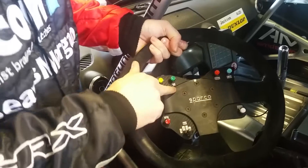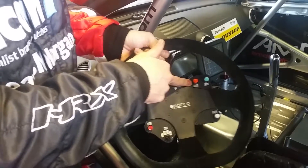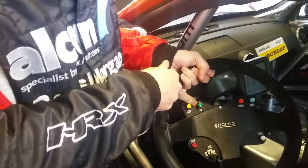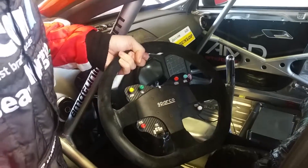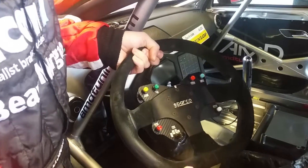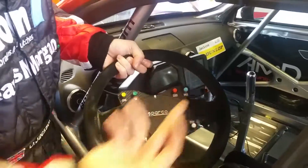These two are quite interesting — it's the push-to-pass and the brake button, though it's not really push-to-pass. All it is is a throttle and rev limiter that we use to start the car. The brake button locks the rear brake circuit. My procedure for the start is: I stand on the brake, hold the brake button — that holds the car in place — push the green button, put my foot flat on the accelerator, it builds up to the revs which is where you can hear all the cars crackling on the grid. I lift the clutch to load the car against the brakes, and as soon as the lights go out I release the brake button and the car shoots off with only a little bit of wheelspin. Usually in tricky conditions it's the best way to start the car, though sometimes if it's particularly hot or grippy you can do a better job of launching it yourself without the button to give it more revs. And then there's the flashing button so you can be an annoying Le Mans style driver and keep flashing people down the straight.